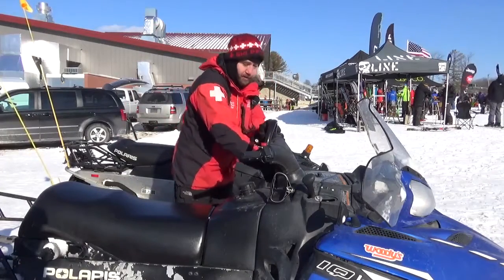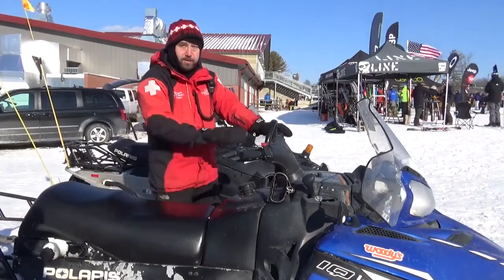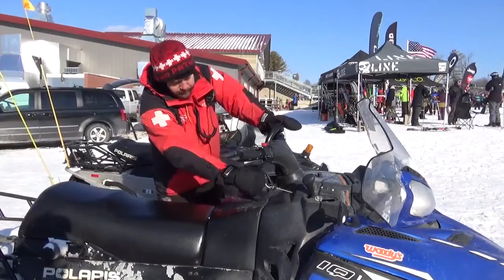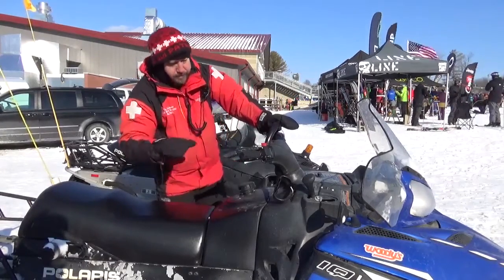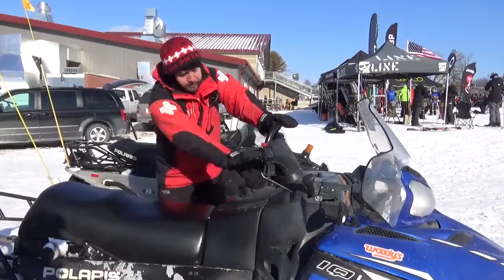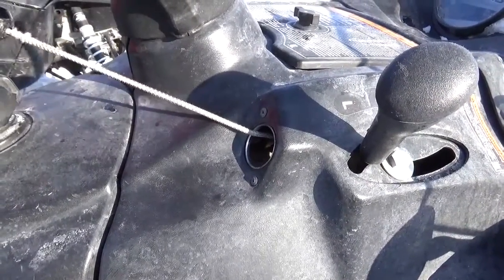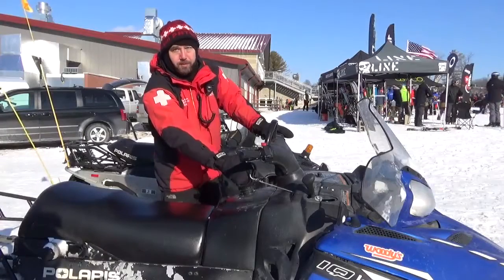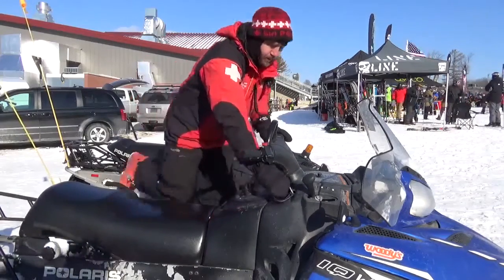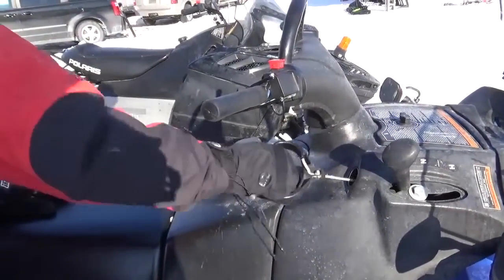There's a start button over here and that has to stay in the run position. Most of these snowmobiles no longer have electric start, so that has to stay in the run position before we actually start it. We're going to take some quick pulls on this. This one doesn't actually have a choke, so we don't have to worry about choking it. We need to make sure we're not on the wrong side of it because the rope will run over the ring and fray. So make sure you're on the correct side of the snowmobile and then do those quick jerks to start it.